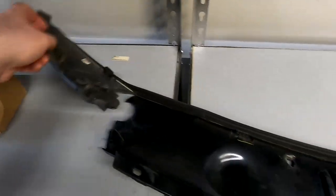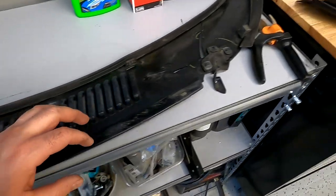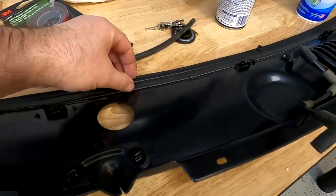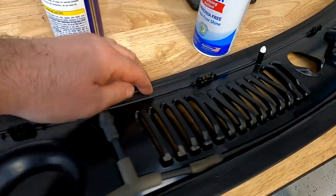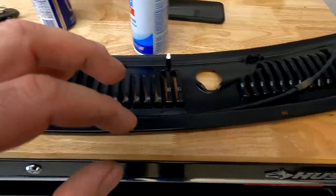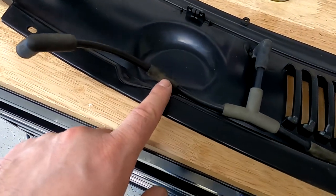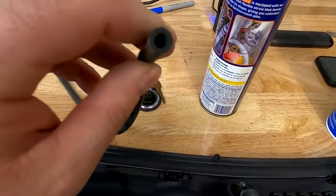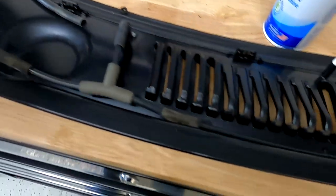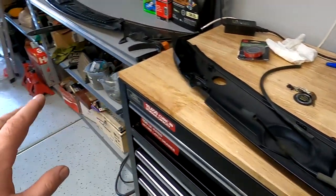Here's a better view of the broken piece outside of the car — as you can see it's pretty much dry rotted. I got everything off of it that I need. The rubber on this is really good, so with the 3M it's as good if not better. I got my water hose replaced — don't be like me, be careful when you pull it out because it is very dry and brittle. I had to fix mine at three different points because they kind of snapped. What I did was use a rubber hose and slit the plastic hose inside it, so this should be good. Now we're just gonna put it back on the car and see the difference.